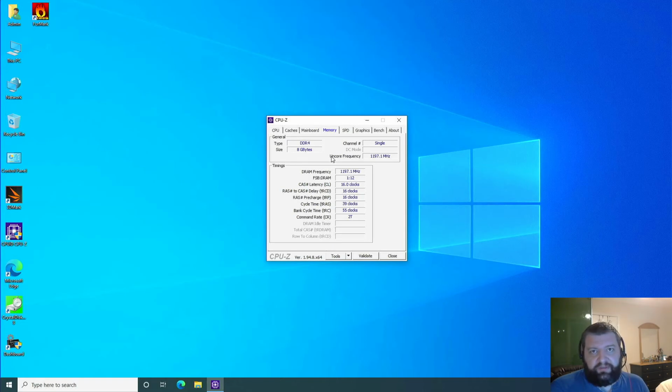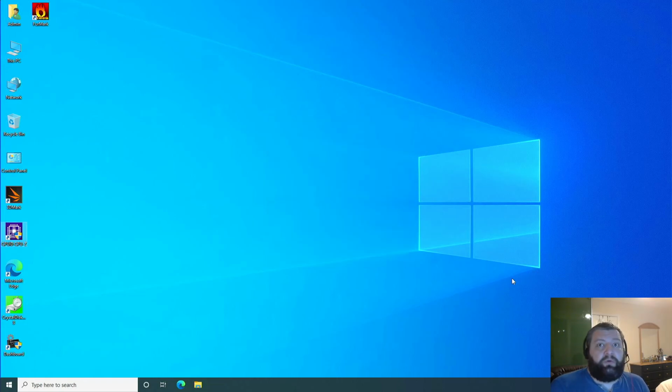The only difference between the previous system that is virtually identical to this one and this new one that we've built in the video is that in the previous system I used the same memory but I used two sticks of eight, so they were in dual channel mode. This different configuration of memory could behave differently than the same memory in a dual channel configuration in the previous build. That's why I may not have hit this particular problem before with two pieces of RAM, and this one, since I'm using single, was giving me this problem. Now, let's see if the problem is resolved. BIOS is set to optimized defaults.